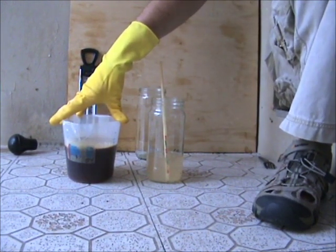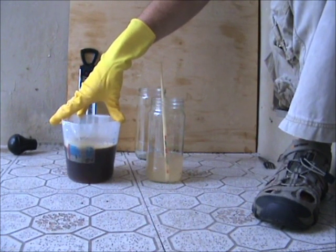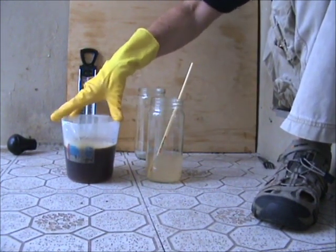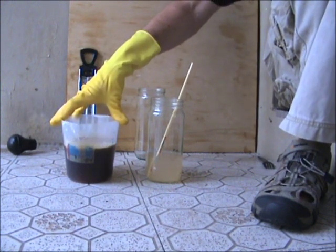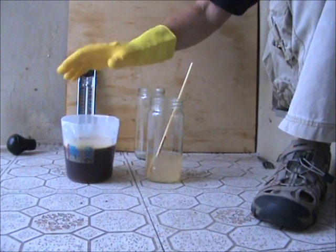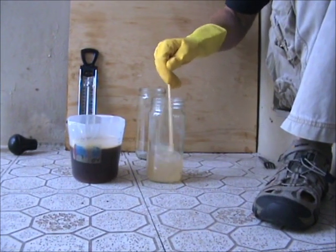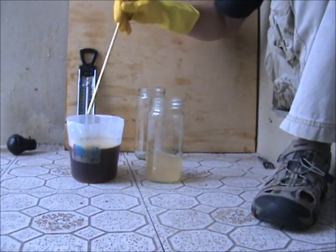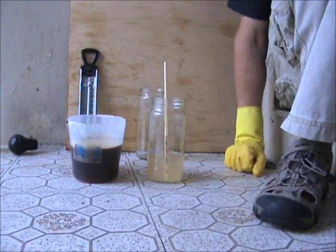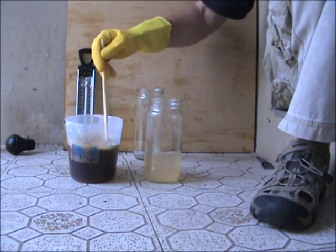As far as mixtures are concerned: during winter time I go with a 75% biodiesel to 25% road diesel mix. With sub-zero temperatures I go with a 50/50 mix. During summer time, anything over 10 degrees Celsius I go with 100% mix, though I actually add 20% road diesel to 80% biodiesel as an insurance just to keep the viscosity down. I'll run my engine on 100% and it hasn't had a problem — I only do that as insurance to keep viscosity down, as it's important for passing through the jets in a common rail engine.